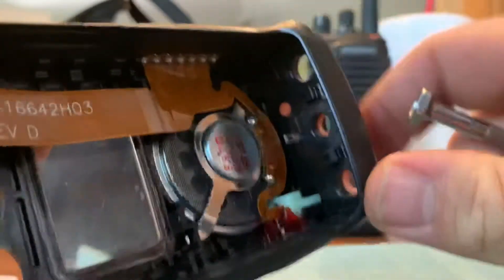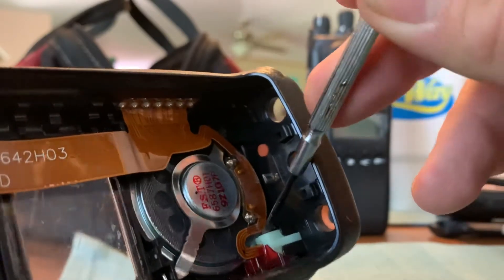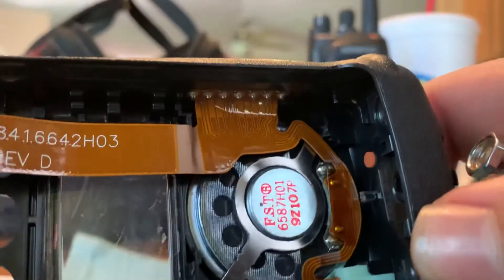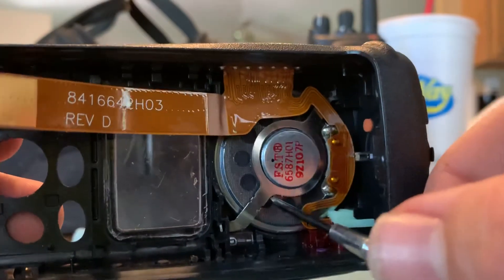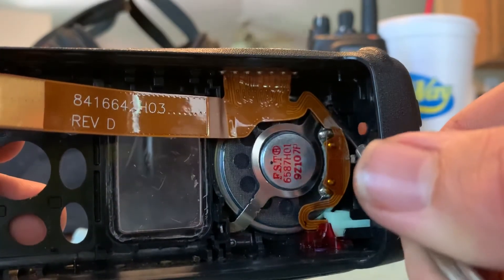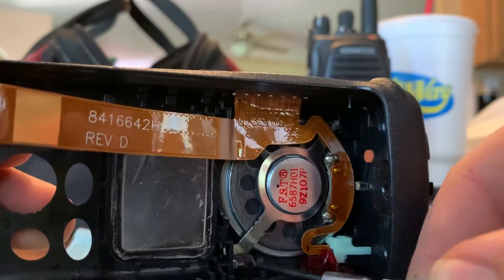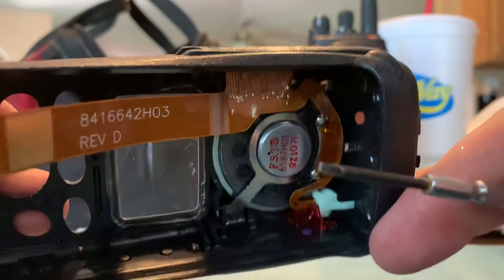You've got this little soft piece right here — this just pulls right out. To pull the speaker out, you've got a little shield guard right here that goes around the die-cast shield. It's got an arm here that goes down and an arm here that goes up. Very carefully push down on this, then pull it to the side — that releases the guard right here, and then your speaker will fall out. Pull your speaker out, and that's it.